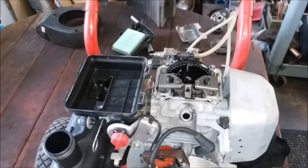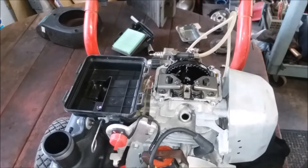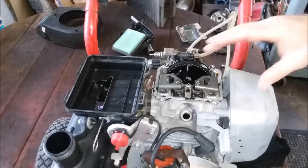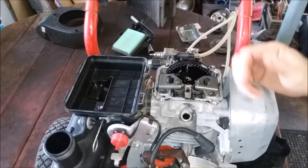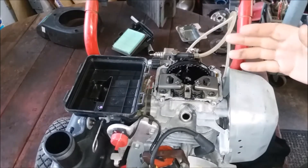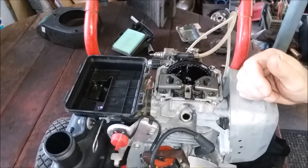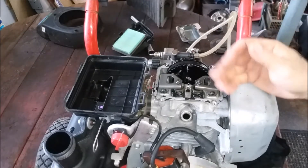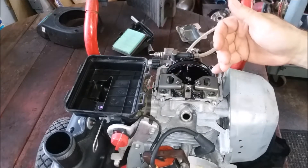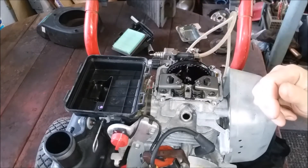I've already brought it up to TDC. Since we have the cover off we can look at the flywheel magnets down here and I can see they're up at the top. I've also gone through the valve events and we'll go through that one more time. We're up where it should be firing in this area and I've already checked them. They're a little loose, pretty close to being perfect. I don't think there's a lot of hours on this motor — probably somewhere around 100 hours. For most overhead valve engines you should be checking and adjusting the valves from a new motor.